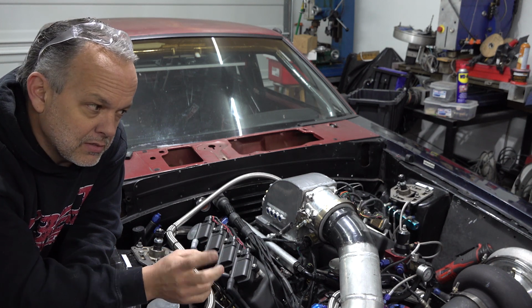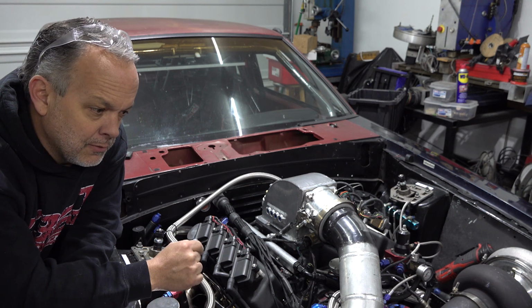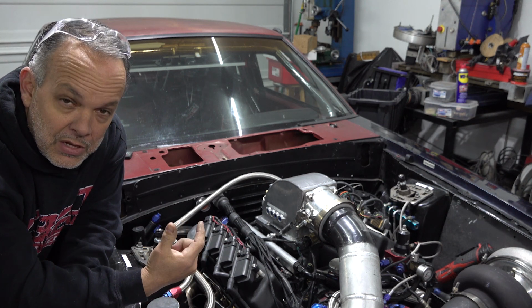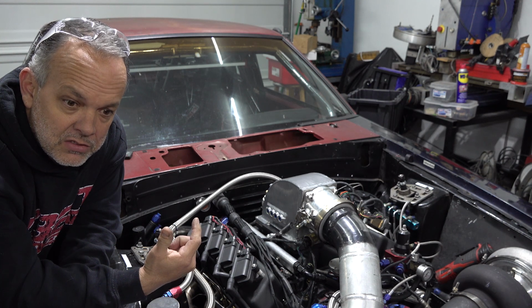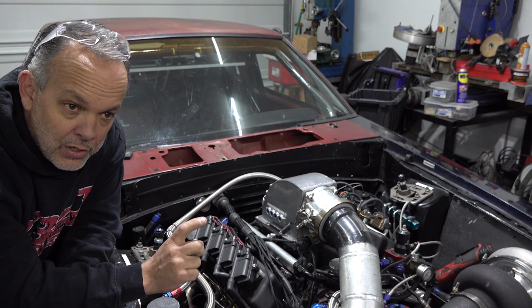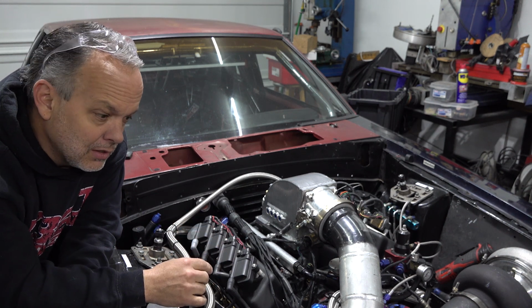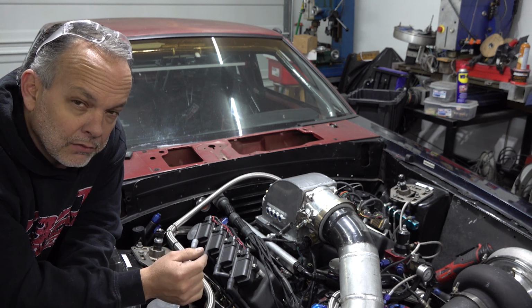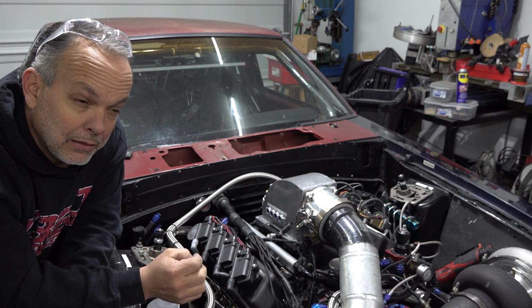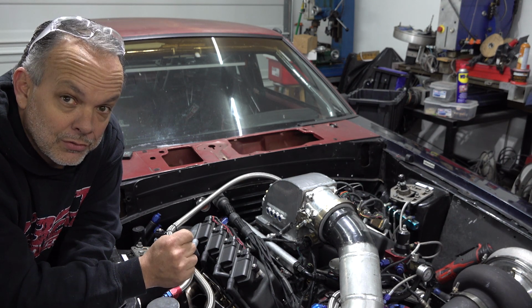The other part of that is I'm going to put the car up in the air and get under there and check the wastegates, pressure check them, and make sure they're not leaking air, because it is actually losing a little bit of gate pressure or dome pressure as the car goes down the track too. So it might be a combination of things, but we're going to check that out and get it ironed out, and hopefully next week we will go faster.